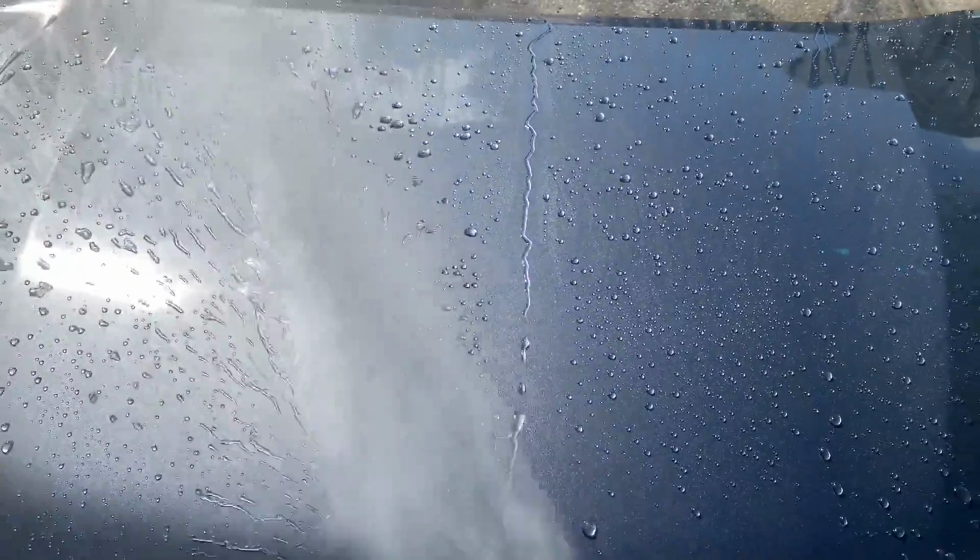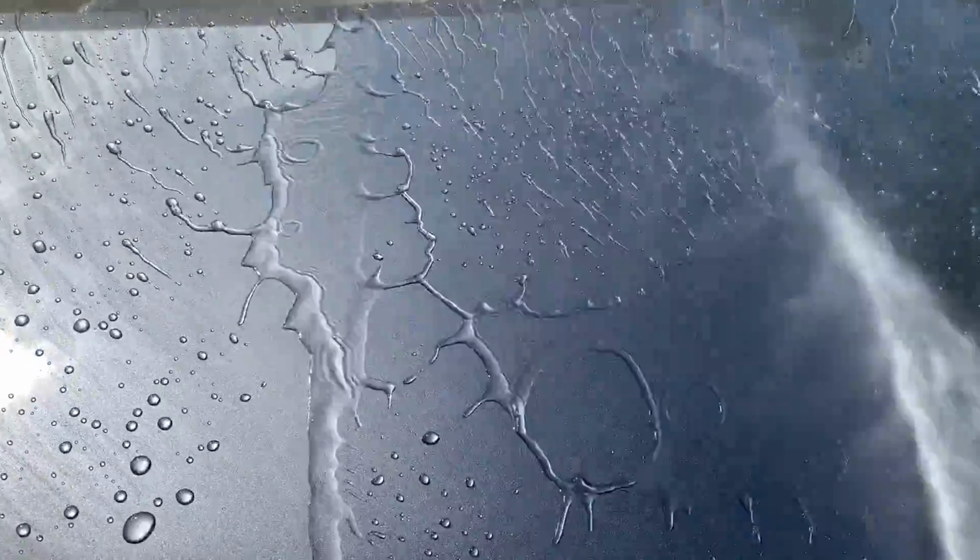But on the paint here, it's not just resisting the oils. It wants to resist the surfactants and the detergents and the cleaners and the greasers. And so when I'm testing these products, the first clue that a product is going to give me that it's highly chemically resistant is how it performs when it's repelling the soap off the surface when I do the first wash test.